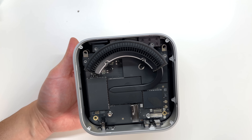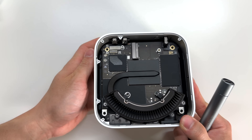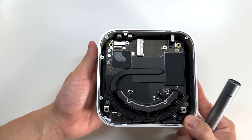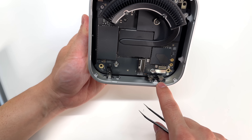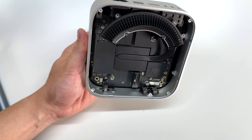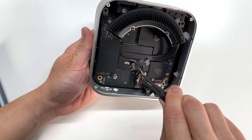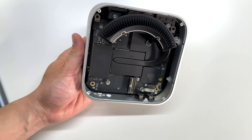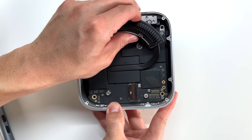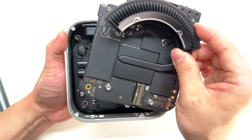The next thing we'll go for is the heat sink, removing two more T5 screws. It looks like the logic board is still not budging, so we will remove the front USB-C connectors as well as the audio jack and two screws on the left. I've released several T3 Torx screws on the front of the Mac and we're going to remove the connectors for those front IO ports — the power indicator, the 3.5 millimeter jack, and the two front USB-C ports. It looks like the logic board is finally free, and with a little help pushing components down to the front we can release some pressure and remove the logic board.